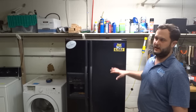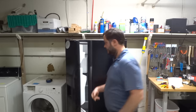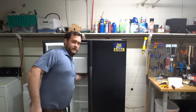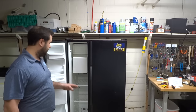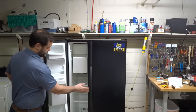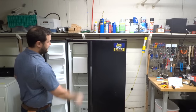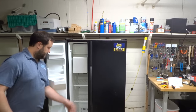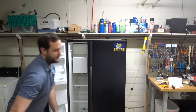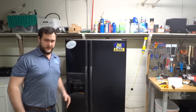First thing you want to do for this problem is check to see if the fans are running. On most models — older models anyway — if you open the door, you should feel back here and feel if there's a fan blowing. If that fan's not blowing, this is not going to solve your problem. You may need to hit a door switch somewhere on here; sometimes that'll turn the fan on. We're looking for a fan back here — it's going to be room temperature, not cold at all. If you see that, then we need to go to the back of the fridge and take a look at what's going on with the compressor.